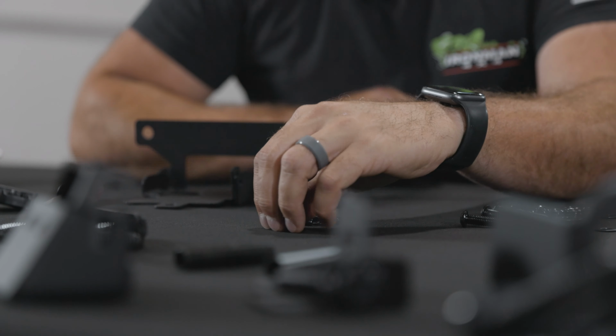We gotta get the grill off this thing, so grab a 10mm. We're gonna pull 1, 2, 3, 4 of those off for starters. With those 4 10mm out, it is time to pop and unlock this grill. So you can start by pulling down here, nice and easy, and you'll feel it start to come apart. And then when you get out here by the headlights, kind of grab up top. There you go. You just want to be muy cuidado.